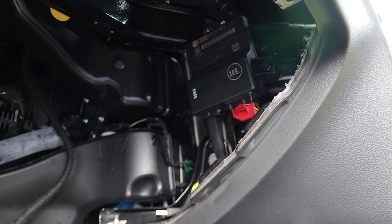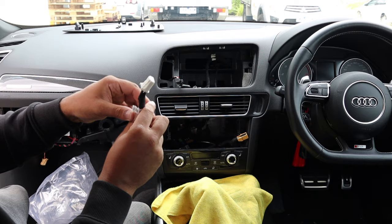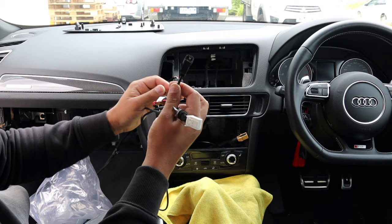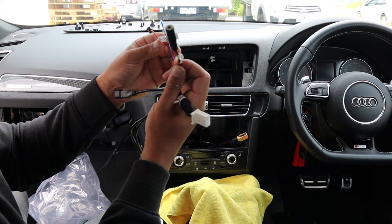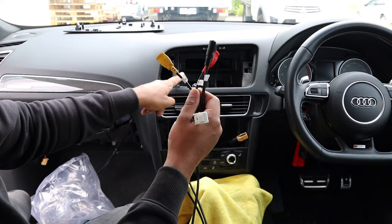This is all the wiring that was in the package. This is our screen connection - it also has the USB inputs on it. That's going to come up and sit right there, plugging into the new screen. You've got an LVDS connection there for screen input, a microphone input as well, and then a couple of other LVDS outputs which we're not going to need - so you can tape those up. On the other end you're left with two USBs.